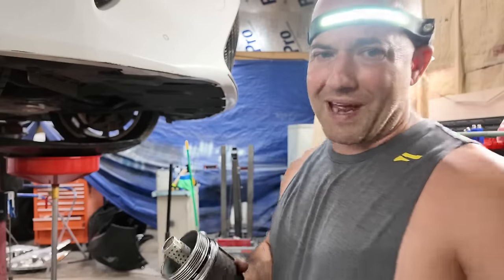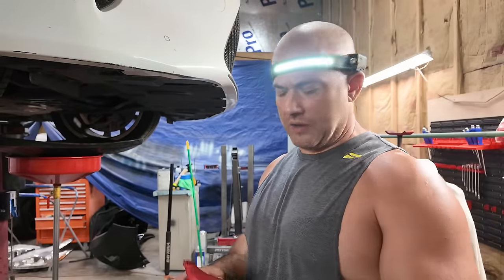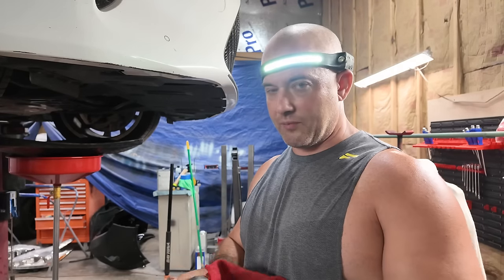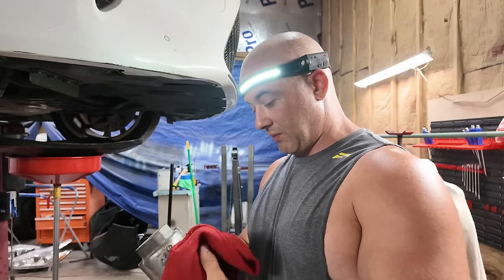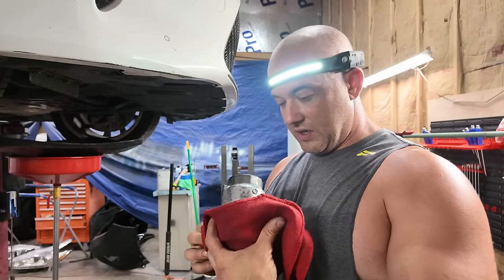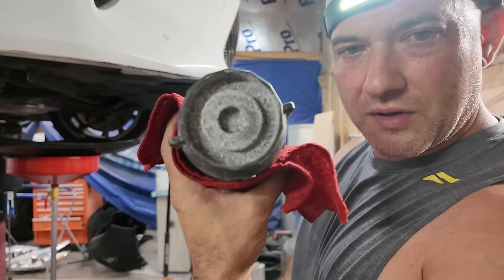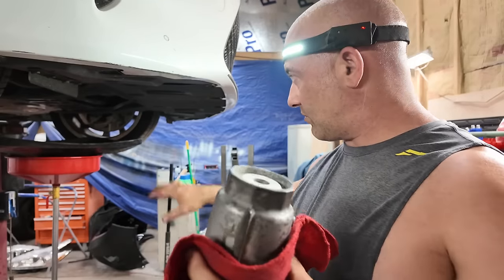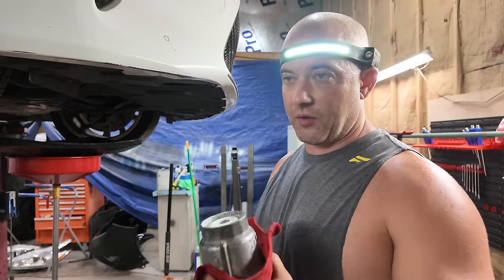The oil wasn't that bad. It's not that bad looking. It takes 5W30. I actually saw online you can use 0W30. I prefer to use a little bit thicker oil. I don't care about gas mileage, especially when it comes to something like this. So, yeah. I'm going to clean this up a good bit. We got the corrosion on the end of it, too. Everything's aluminum. The aluminum block, all the accessories, everything's aluminum. So, I'm going to clean this up anyways, make it look a little bit better.